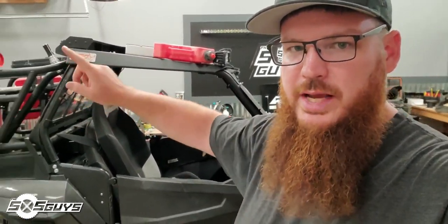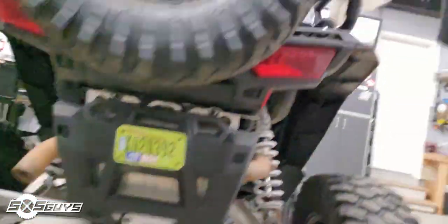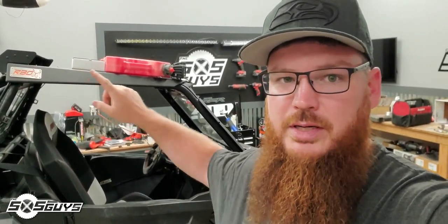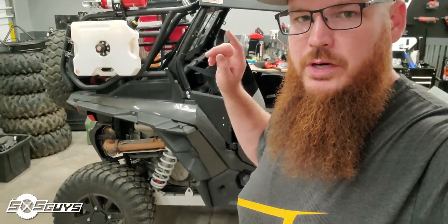We have the Razorback Off-Road full windshield, roof, rear windshield, and rack. Those things added a lot of weight to the unit. We never really had time since we were putting shocks on the trail to preload everything correctly, so if you look at the squat on this thing, it's real and it's not even loaded up right now. We've got to adjust the preload springs. I need to take the roof off because it developed a rattle over the last trip — I didn't even remember, I was so busy working on stuff — and put the stripping under the roof so we don't have rattle on the trip.